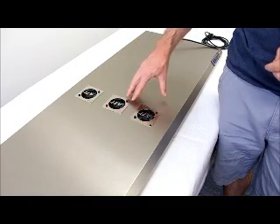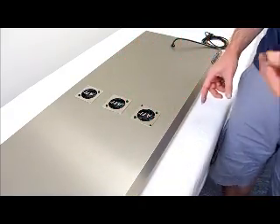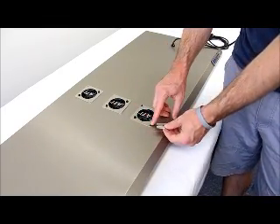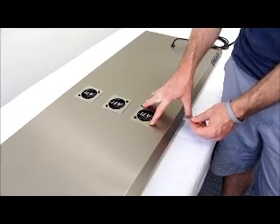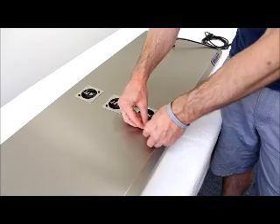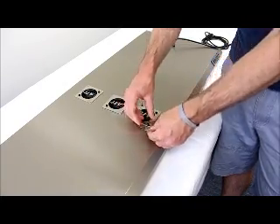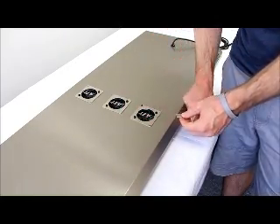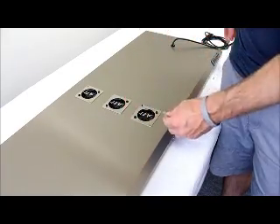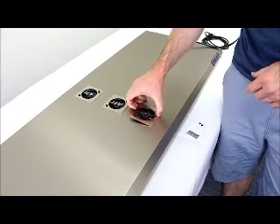In order to troubleshoot this, I'm going to pop out all three fans and make sure all the connections are solid. To do that you just need a flat-bladed razor blade and you're going to wiggle it underneath the two plastic rivets that are on the outer edges of the fan guard. Once you've got that out, the fan should just come out real easily.